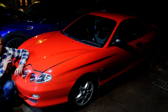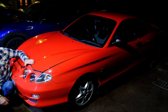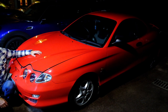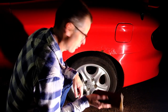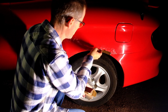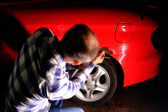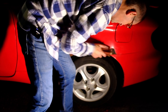I've been polishing and polishing after the Ultimate Compound cut, then gave it a quick blast with some old polish I had in the cupboard. Apart from the scabby bits on the plastic front bumper and where the paint has crinkled on the boot lid where it was under green stuff for so long, it actually looks really quite nice. It's fairly thick, tough paint on this car — I'm pretty impressed. Well, it's too late for power tools but it's OK for a bit of hard labour. 80 grit on a block — let's see what comes off. It might just be easier to pull chunks of paint off.